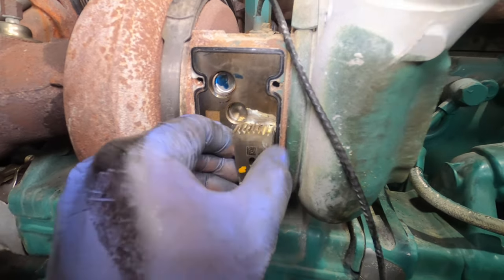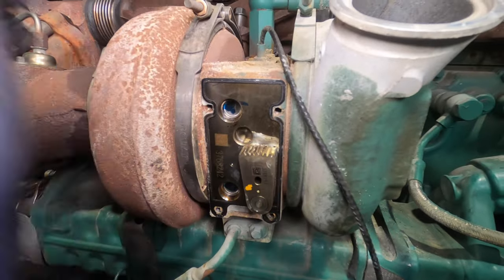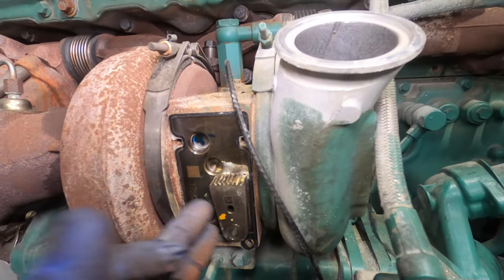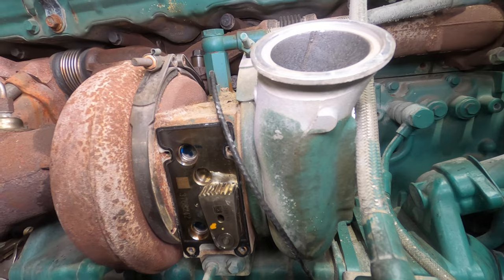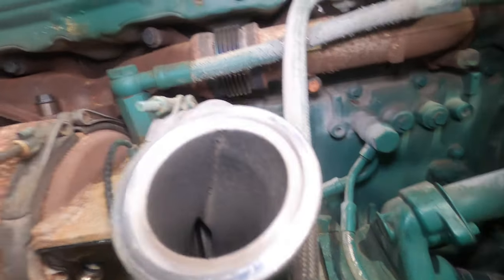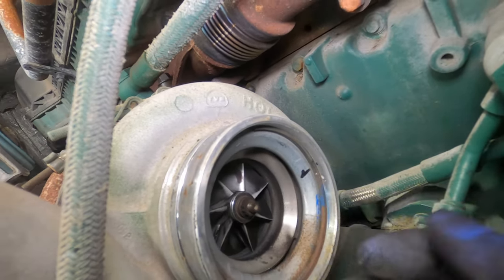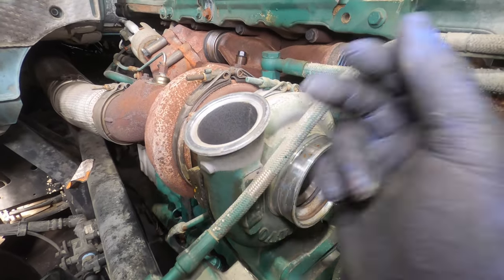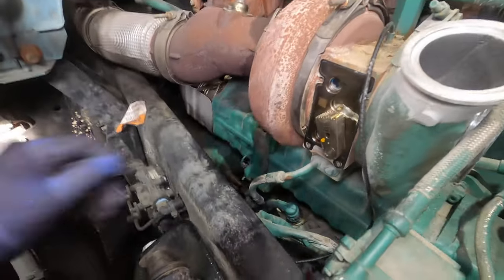You guys got to mess with the sector gear a couple of times to see if it's binding — and that's just once or twice. That's a sign that it's failing, most likely due to soot buildup. Yeah, that's why we're having that code, and the reason why the engine was sounding the way it was and choking out on us. So we're going to go ahead and remove this turbo and replace it. This goes to show you that you don't have to have an oil failure or a bearing failure with oil coming out or fins broken on the turbo to have a bad turbo. There are lots of signs of it — obviously those are the most common ones. You'll have oil coming on the inlet side or the outlet side, or too much play on the shaft — the bearings are shot. But this is also another failure mode.